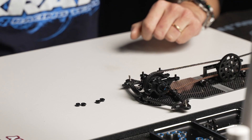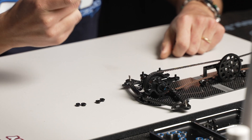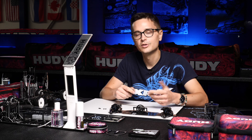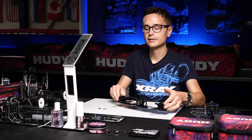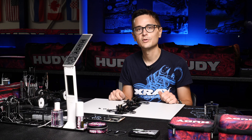The kit setting is a very stable, very neutral setting, but whenever you need a more aggressive car you go towards more rear caster. It's very easy to adjust with these aluminum inserts. And that's everything about caster on the X4.